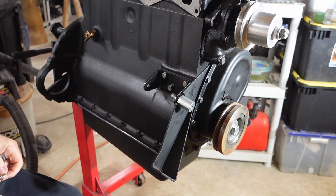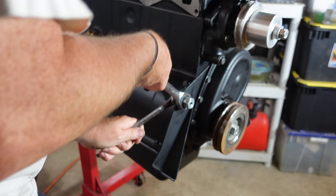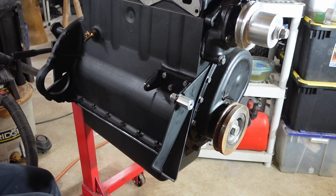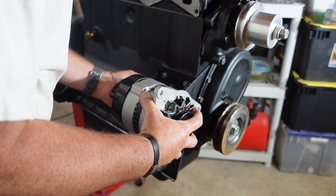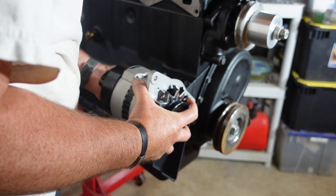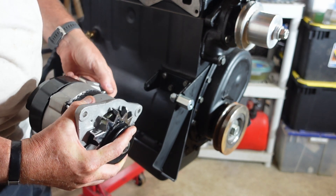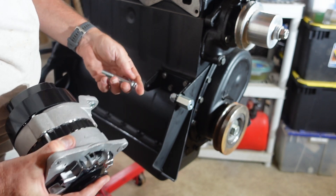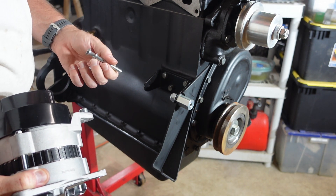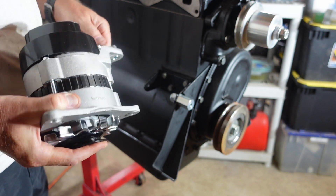The instructions aren't that great, to tell the truth. I'm going to go ahead and put this thing on and tighten it down, then come back at it — that way I can get that mounted and give me something to rely on. So what happens is the front gets mounted like that into there, but I think I'm going to have a problem with this spacer here. The alternator needs to go back quite a ways still to get that front screw in. I've got to move that adjustable spacer out so that this bolt comes forward and allows me to set that generator back about the entire thickness of the spacer. And I think unfortunately what that's going to do is I'm going to run out of thread on the back here — this bolt's not going to end up being long enough. Let me try that.